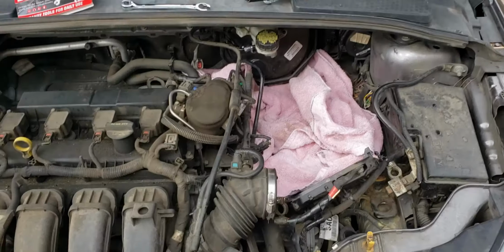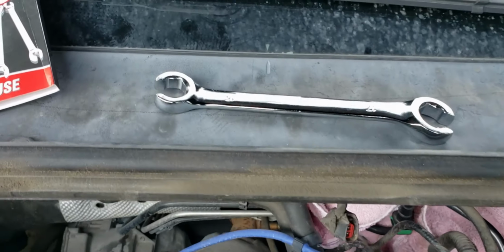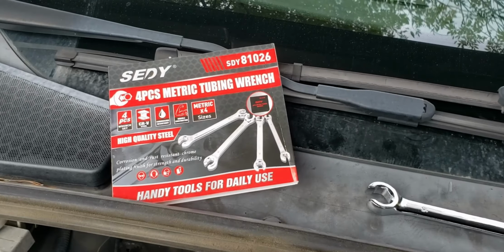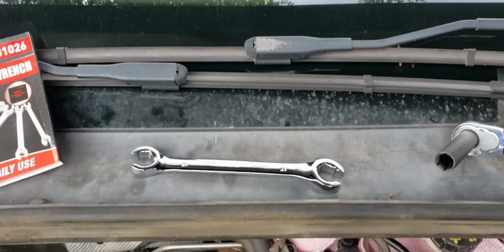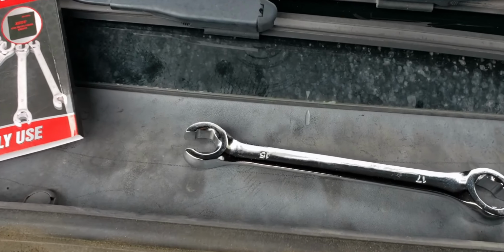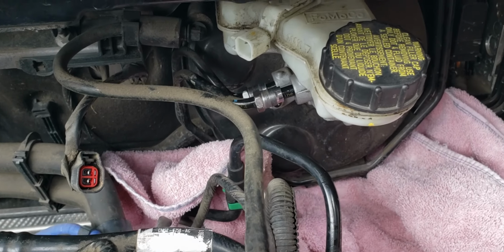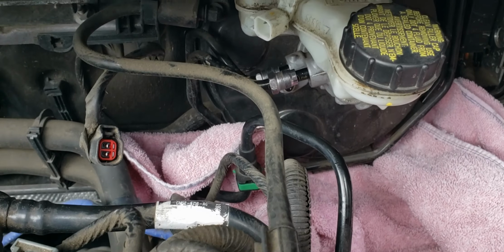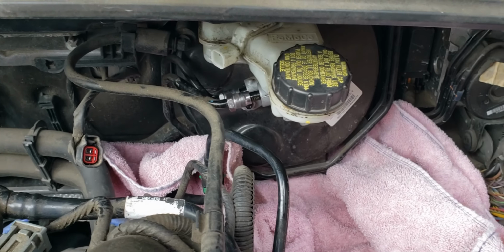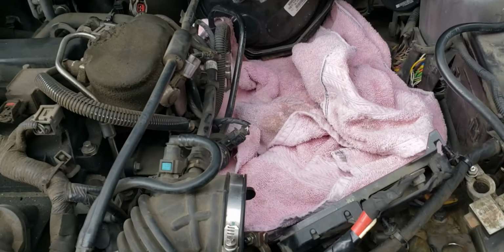So we'll see. All right, so we were able to get the brake lines loosened, and it's actually going to be a 15 millimeter spanner wrench or tubing wrench, or whatever you want to call it, flare nut wrench. That's what I was using, not a sponsor, just what I used. But it's a 15. And just so you know, the flare wrench only goes on in one certain way, it seems like. So if it feels like it doesn't fit, just keep trying. It'll probably get there, at least if the 2014 Focus is already working on the 15, it's gonna fit.